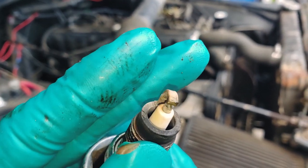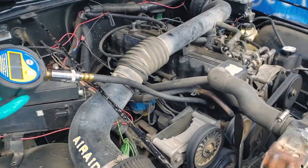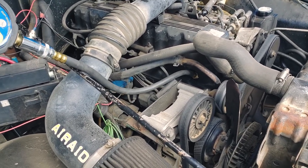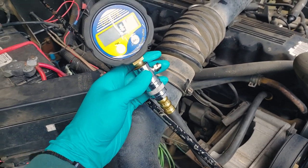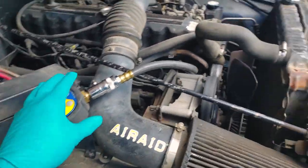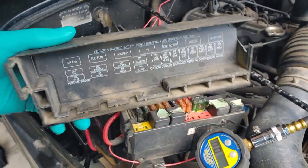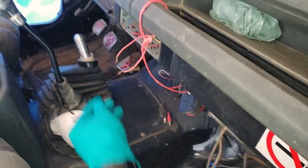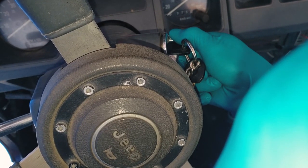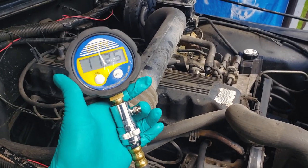The spark plug's a little white, but there's a chunk of something on the end of it — probably nothing too major. So how one of these compression testers works: you thread it into the existing spark plug hole, it acts like a spark plug, thread it in a little snug by hand, press on, and crank the engine. Before you crank the engine, make sure nothing's in the way of the fan. Pop open your fuse cover and remove the fuel pump relay or fuse. My fuel pump's broken so I'll just leave it disconnected. We'll crank it over four or five times. Cylinder one: 112.5. Press this and that releases the pressure.